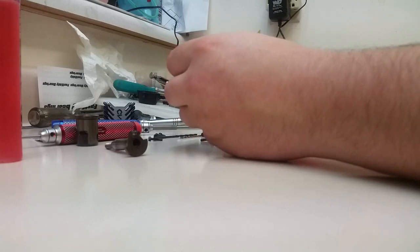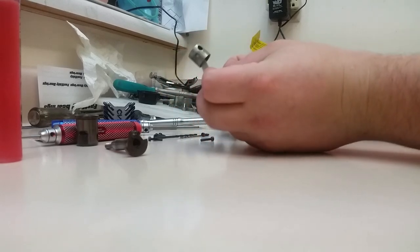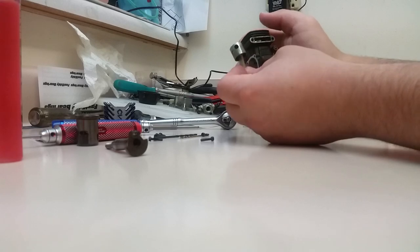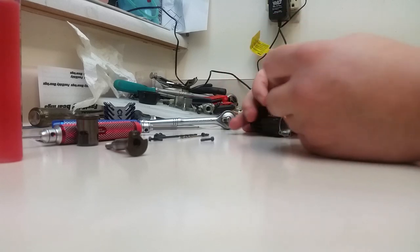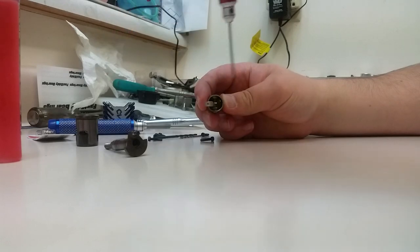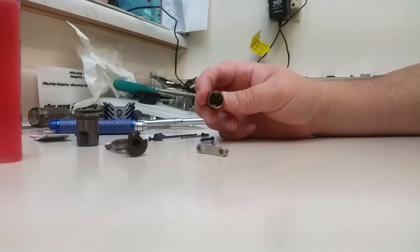But with this engine here, you'll notice that there's a hole in the piston, like that. That always faces this side of the block, because if you put it in this way, the engine just won't run. If you see that hole through the exhaust port, it's never going to start. There's no wrist pin retainer, so you don't have to worry about that. The wrist pin just slides out and the connecting rod falls off.